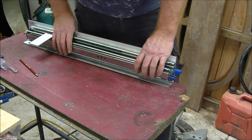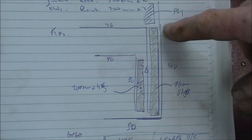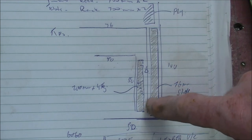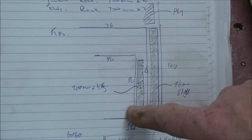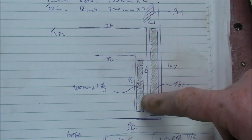Next we'll quickly go through a pen diagram of the dimensions. Here's a simple drawing of what the slides look like and how the aluminium angle is going to come off it. I'm using 3mm thick aluminium angle. To start off, we've got an unequal angle of 100mm by 50mm. For the actual fridge slide support, we've got 76mm by 76mm. And to support the table angle, we've got an equal angle of 50mm by 50mm. The inner fridge slide or table slide is 45mm by 12mm.